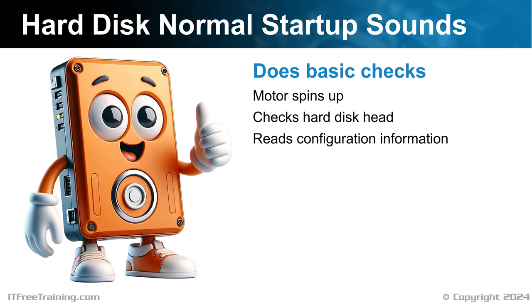If you don't hear the typical sounds from a hard disk, it might indicate a problem. These sounds are often quiet and hard to detect. You can try feeling the hard disk for vibrations, especially when it first spins up. USB hard disks might be harder to hear due to them often being inside a plastic enclosure. Normally you should hear the motor spin up, followed by the read-write head moving, then returning to its parked position. If the motor spins up but the head remains still, the drive might be failing. But remember, some drives are quieter than others.